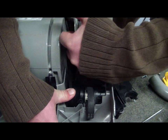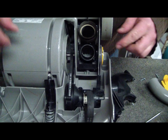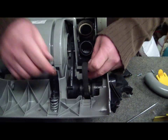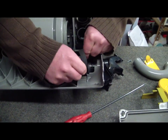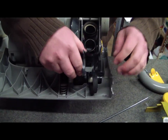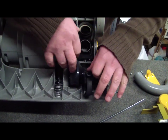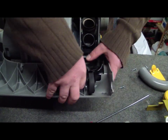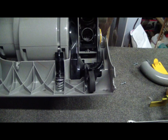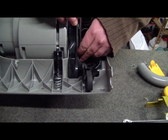Lift up your belt over the shaft and just give it a turn to make sure that it's running. And make sure that's running freely too. Now we put our clutch cover back in — you'll feel it firmly press into place. And do up our three Torx screws.